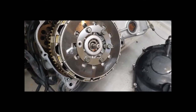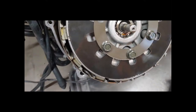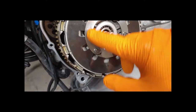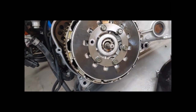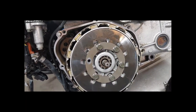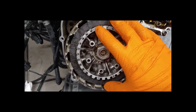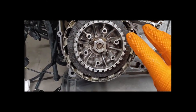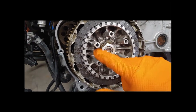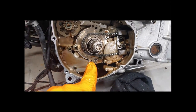There's the clutch. Looks like somebody stripped out one of the bolts. Anyway, there are other things online that show how to get these clutch baskets off. Basically we're taking these bolts out and removing most of the basket with all the plates. From there we should be able to see the starter gear. I pulled off the front half of the clutch and pulled the clutch packs out — they actually all look good. You can mic them to check thickness, but usually you can look and see you've got plenty of pad left. Now I'm going to use the impact to take off the main nut and pull the whole basket out. Clutch basket off.